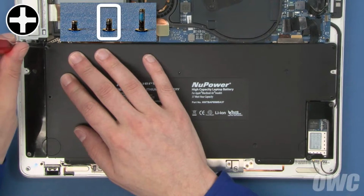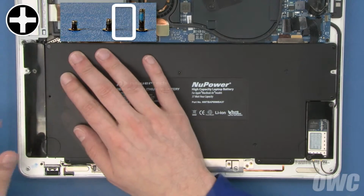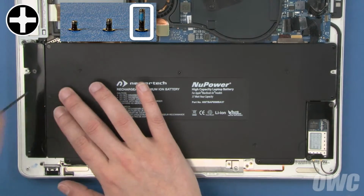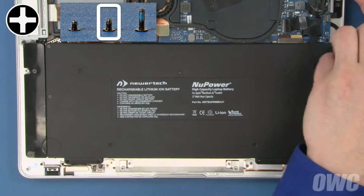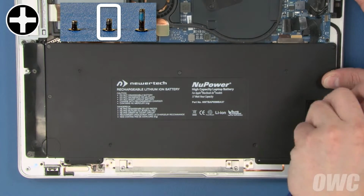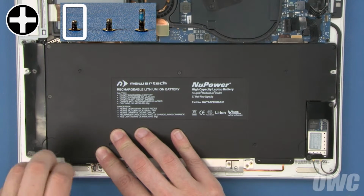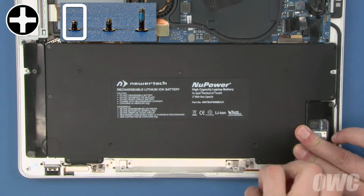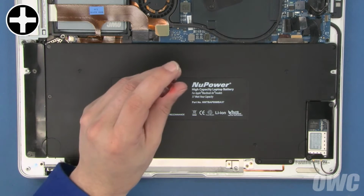Start with one of the middle-sized screws and use it to secure the upper left corner. Next, use the longest screw in the hole just beneath it. Then, use the remaining middle-sized screws in the center and 2 upper right positions. Finally, use the 4 smallest screws along the front edge, starting from the left. You should then loosen all these screws about a quarter turn or so that the stresses inside aren't too tight.